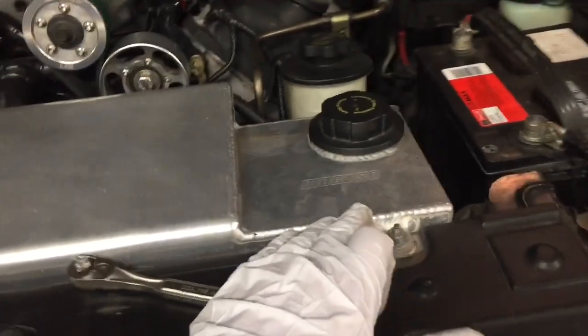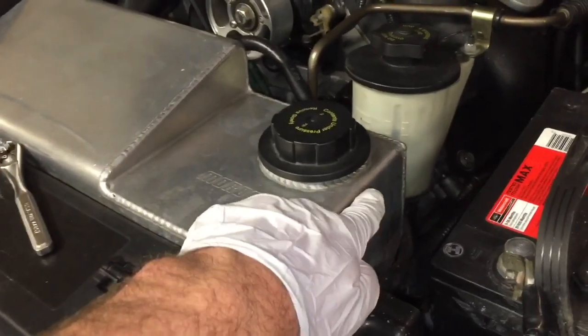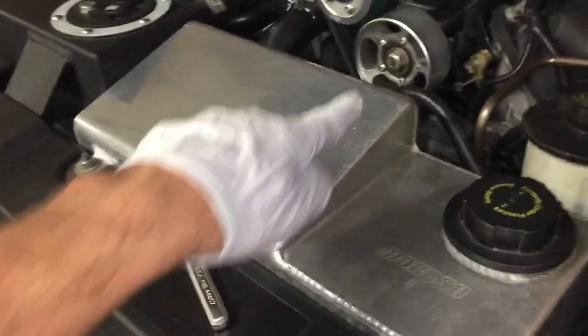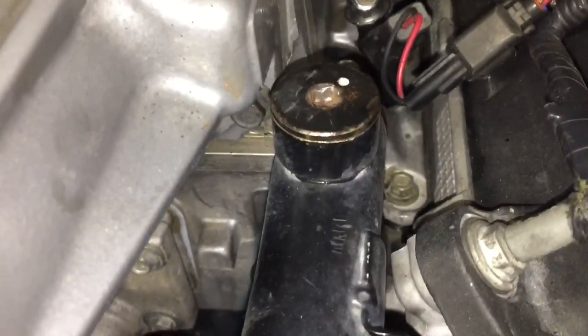For this particular tank, because you'll see other tanks on the side, it'll say the maximum fill line. This one, the maximum fill line is pretty much here because it has the expansion air section here, and that's where any excess will go out of this tube and back into the radiator. So anyway, at this point, we just want to drive the car around, get it to full operating temperature. Okay, the coolant crossover plug is tight again. And then we just went over and we lifted on the driver's side. And now we're gonna lower it here on the passenger side with our blocks of wood here so that we don't hurt the side of the car since this car is lowered.